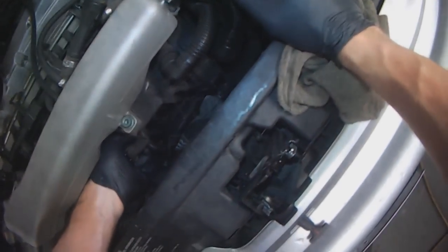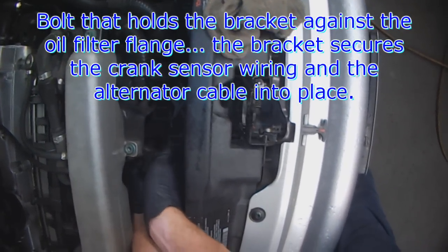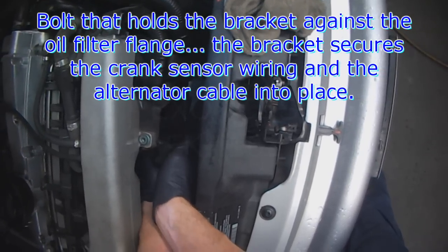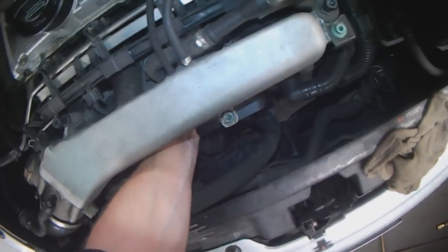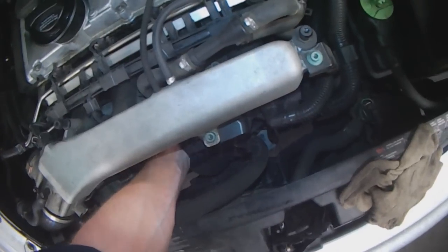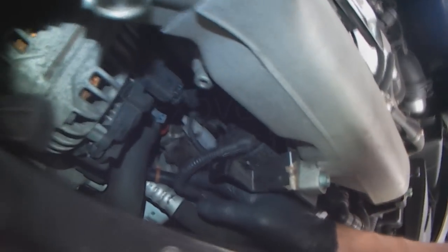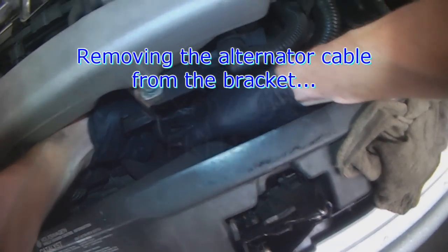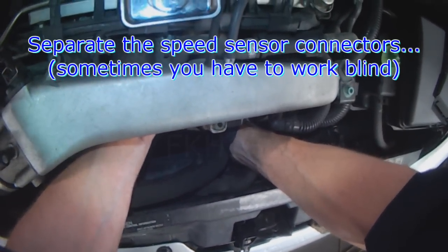The headlamp battery is almost dead, I have to find a better pair. The engine is nice and warm right now, which makes things exciting to work on. There's a little screw — now this bracket is loose, and you can see the harness plug might be easier to get to now. You can also unhook the alternator cable from this bracket, then lift and grab the harness plug and pull it out of the bracket.